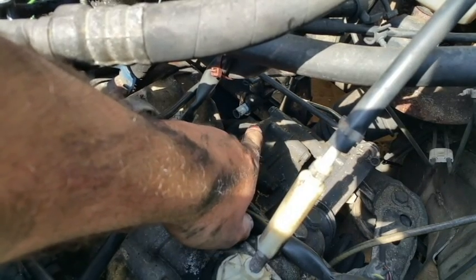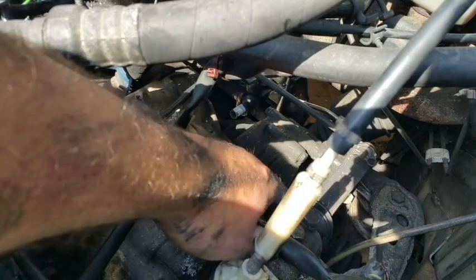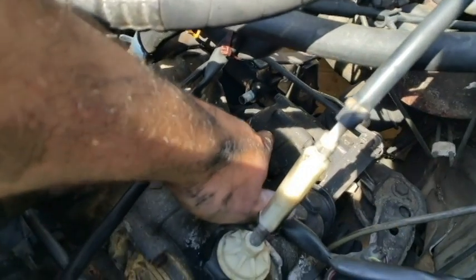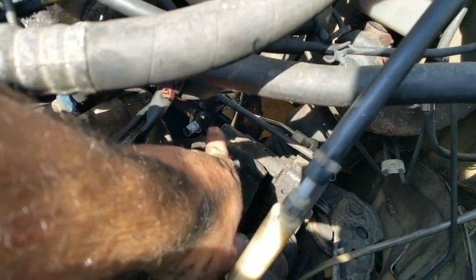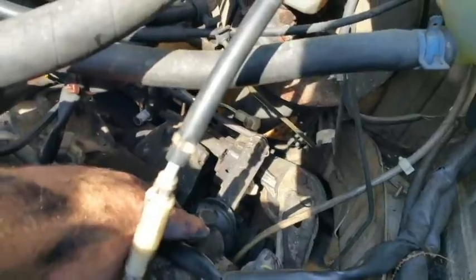And when you go ahead and tighten it, you're gonna want to make sure you can get in every gear. Now me, I've tried it all and I got in every single gear, all 5 gears including reverse. And there's the other arm that we installed earlier, and the rubber grommets that are on each one of those are all installed.